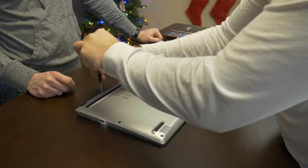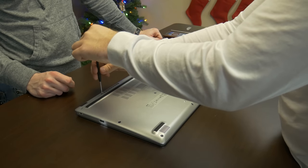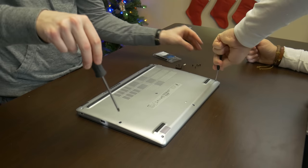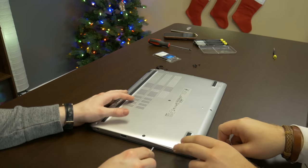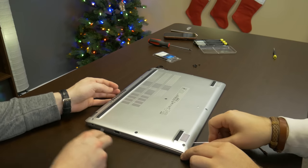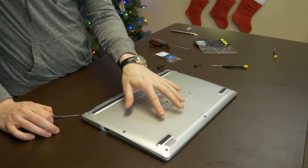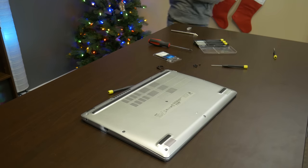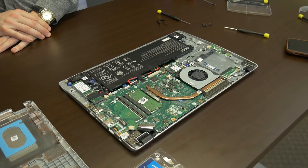In terms of upgrading this laptop, the teardown was relatively easy. It was a bit hard to find a specific tutorial, but all you need to do is remove all the screws on the back plate and carefully pry around the edges with a guitar pick or pry tool. You just have to make sure to lift up all the clips around the edges slowly — they're pretty durable — and once you get the back plate off you can see all the guts.